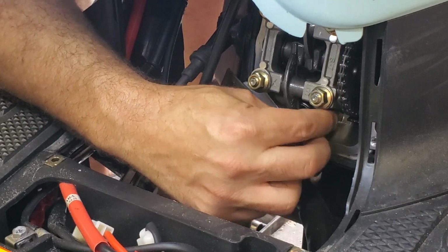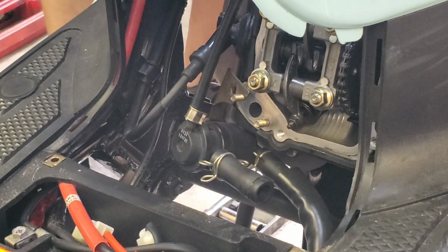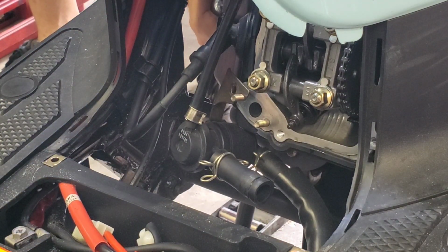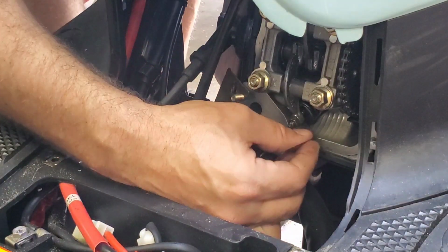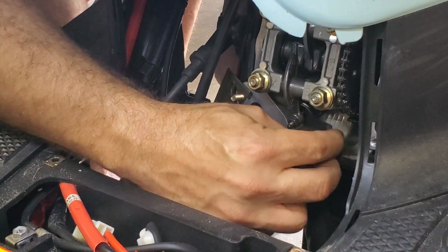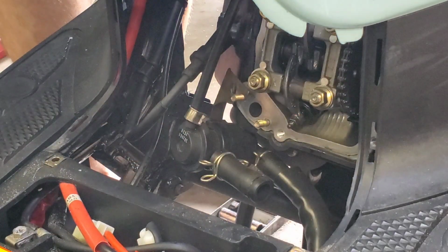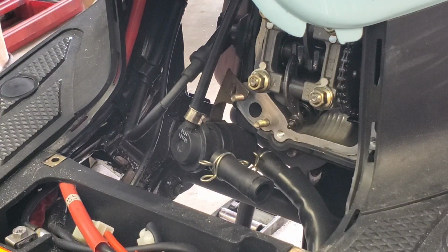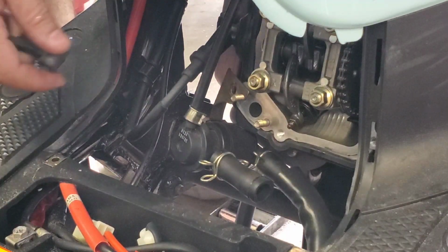All right, well, the exhaust is a little tight. I can get underneath it, but it is slightly tight. Let me just make sure it's not the turning of the motor here. Just slightly adjust this a little bit more to make sure. Yep, nope, that valve is set just slightly too tight. It has play, but it is a little too tight. So I'll adjust that valve real quick and grab my valve tools, and then I'm gonna have a really good look at the seats.